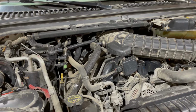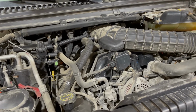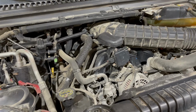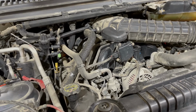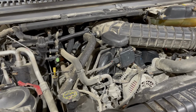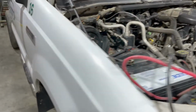It's making some rattling noises. Justy said it was from down low. I don't think it is. I think it's probably the head. Timing chains went bad, the adjusters went bad, starved the right rear of the head, most likely, just like they do on these V10s and 5.4s. So I think that's actually what's going on with it. But out with the V10, in with the 5.4 in the 6-speed.